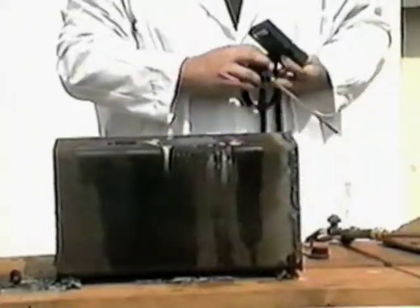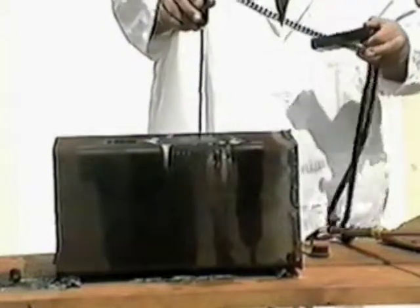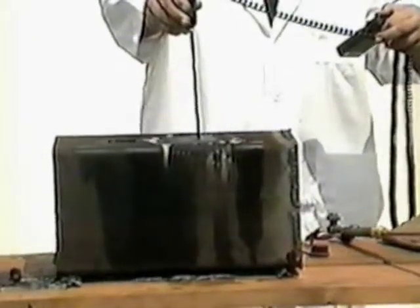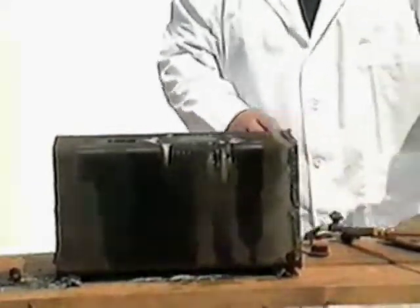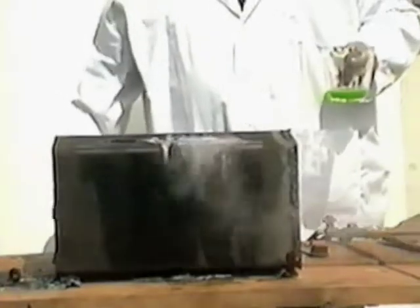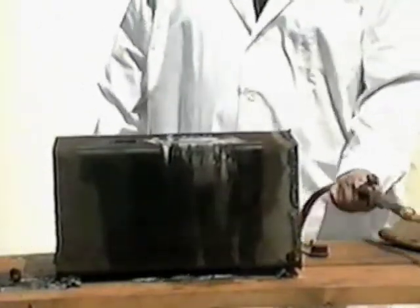That's about 650 degrees. We'll try our experiment a second time with the pure solution of coolant. We're unable to catch our mixture on fire at 650 degrees. However, it will catch fire readily between 1,200 and 1,300 degrees. Obviously, if our pure mixture won't catch fire at 650 degrees, there's no sense in testing our 50-50 mixture of coolant to water.